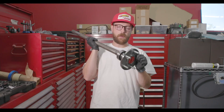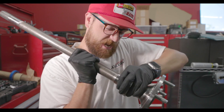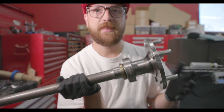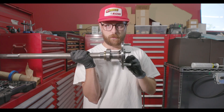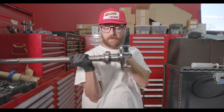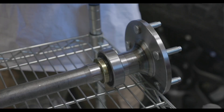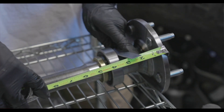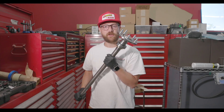If you don't know what your brake offset is, there are a couple of ways you can measure. This is a press-on bearing axle shaft — POB, bolt-in — called that because the bearing is pressed on and can't be taken off. This bearing is in a fixed position, and it dictates your brake space; that's part of the equation that goes into setting your brake offset when making axles. If you don't know your brake offset, you can measure from the outside face to the outside edge of your wheel bearing, specifically the outer race. Hook your tape on the axle flange face and pull to the bearing, using a straight edge from your race to get that dimension.